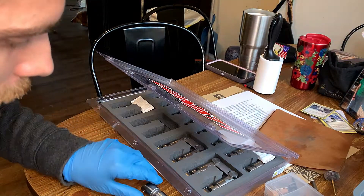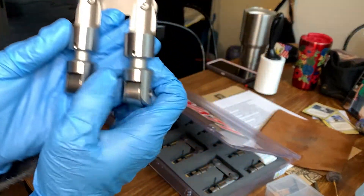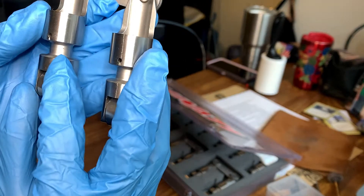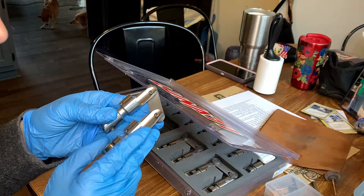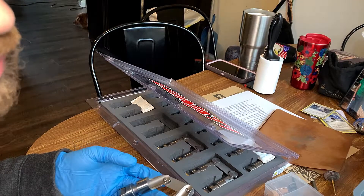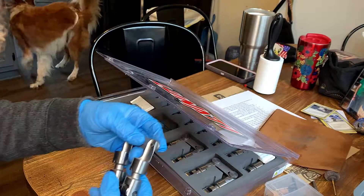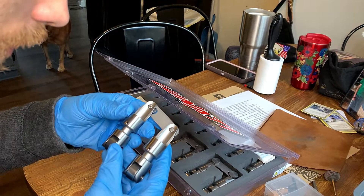My goal is to put about a 30-thousandths little divot — you can feel it, it's just a tiny groove. Just enough to get some oil up there because the lifter bore is a little tight. That'll send adequate oil up to the top end. You don't want to send too much — the valvetrain just needs to stay lubricated, not bathed in oil. You don't need two or three quarts filling up your valve covers; just enough to keep things nicely coated. I think this will do the trick, so I'm going to do 16 more just like that.